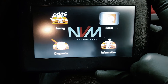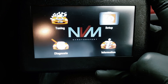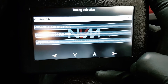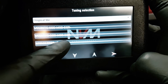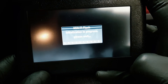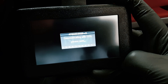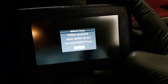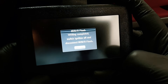Back in the vehicle, we've connected the NVMR to the OBD port. We've put a battery stabilizer on to keep the voltage above 12 volts. Turn the ignition on and click on tuning. This will give us the option — we've got an original file and three additional files for this vehicle. So we're going to click on the latest version for a stage two. It will say initializing in progress, and then it will start writing that file to the ECU. Now the writing has been completed. Following the on-screen instructions, switch the ignition off and you can disconnect the NVMR.